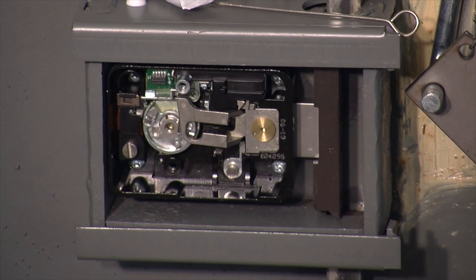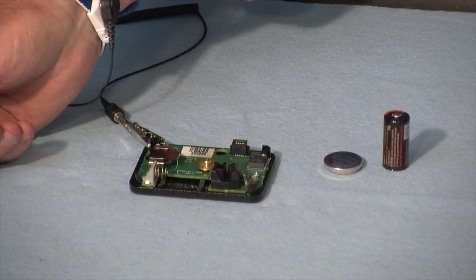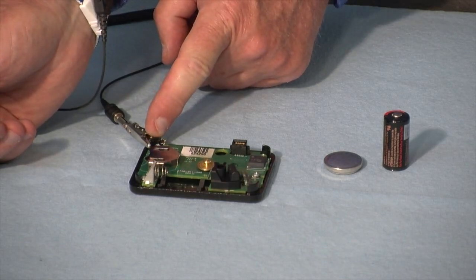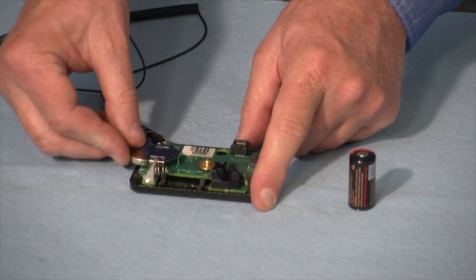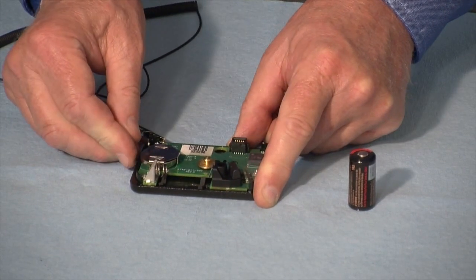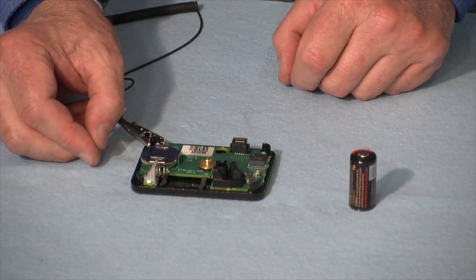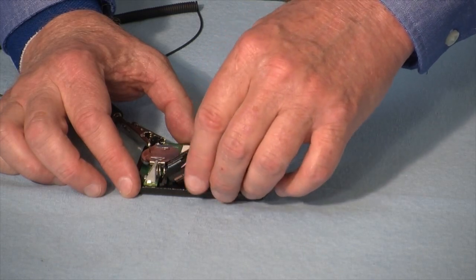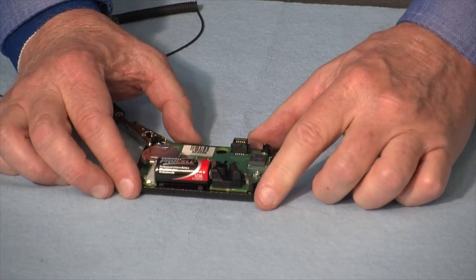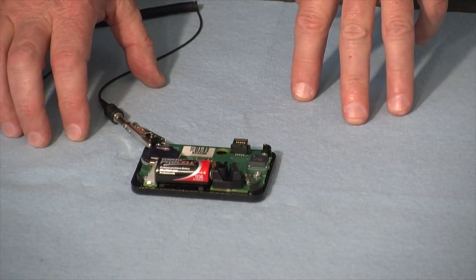Time to install the batteries in the cover. Notice that I'm wearing my grounded wrist strap attached to a piece of metal on the lock cover. We have two batteries. One is a lithium coin cell — it installs in this holder positive side up, and it's a friction fit so it needs to be pressed into place. Typically we put in the coin cell first. In the S&G Model 2740B it isn't critical which battery you put in first, but it is critical that you install the batteries within one minute of each other. Now install the camera-type lithium battery — when I install it you'll hear a single beep, and after about 10 seconds the lock will beep again, telling us the battery test has been successful and the cover is ready to be installed on the lock case.